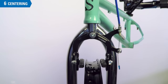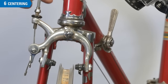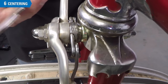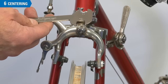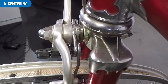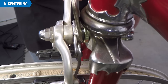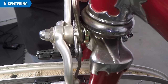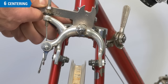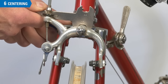There are some models that have a machined stud designed for a thin wrench. The OBW-4 has four sizes depending on the model. In this case you are grabbing the stud directly. We still use a wrench behind on the mounting nut, and both wrenches are moved in the same direction, the same amount, and that will move the pivot stud directly for our centering.